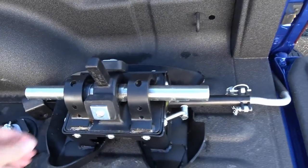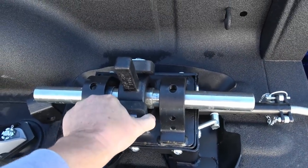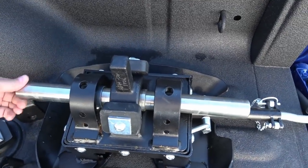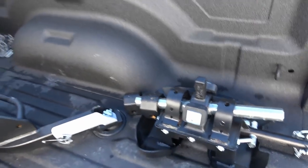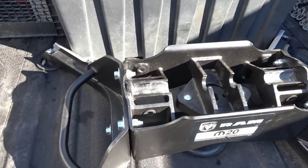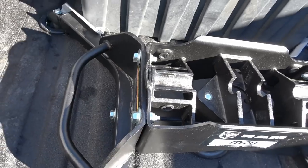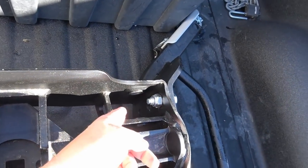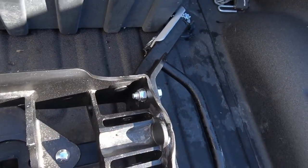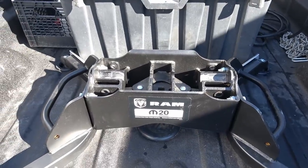There are some rubber stoppers there — just help the ride. A big pin goes through there and these things kind of fit in there, and the pin goes in on both sides. So it has some nice side-to-side play as well as front to back. There are three bolts on each side and I looked at the torque ratings — they're all about 100 pounds. These are the two on each side that you adjust the height. If you look in there, there are three holes so you can adjust it up to six inches up or down. I think I'm going to try it at the lowest setting right now and see how that works out.